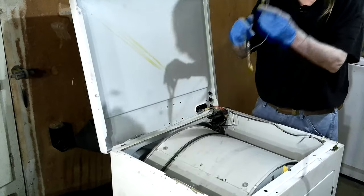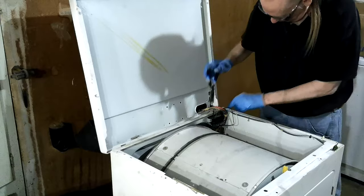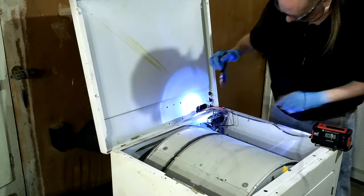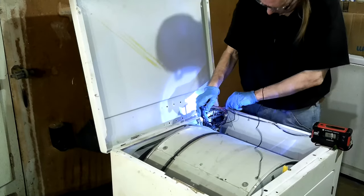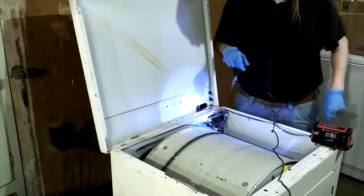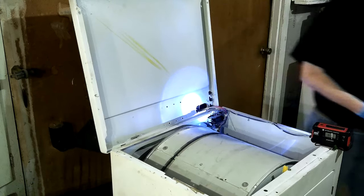When you unplug one, then the other end of that's going to be electrically hot — it'll shock the living fire out of you. These are insulated handles too. That didn't make it go. The two wires going into the heating element — you don't want to jump across those. One of them is going to be the hot and one's going to be the neutral, the common.